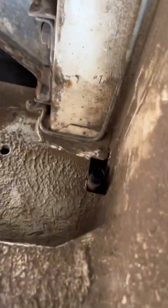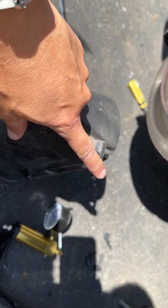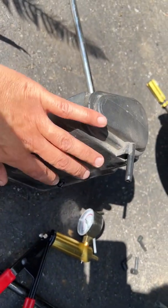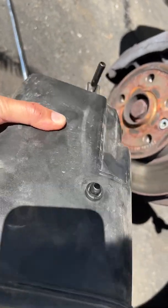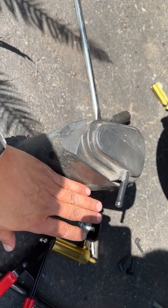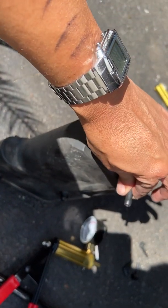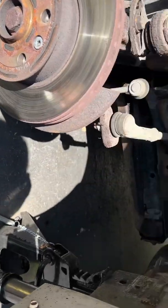There's only one hose that connects to that evaporative container, which I found confusing. I found that if I blew in this end it would immediately come out of this end, so this didn't seem to be blocked, although I think at some point it must have been. When you shake this around you should hear the charcoal rattle around, and I'm hypothesizing that at some point something got jammed in here and caused pressure to build up in the system.